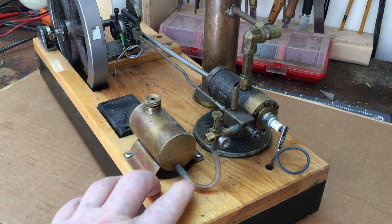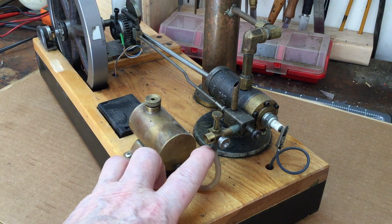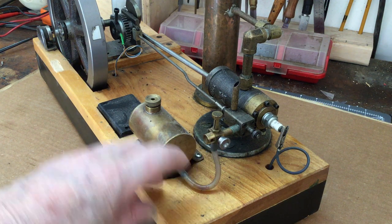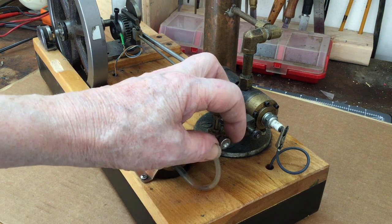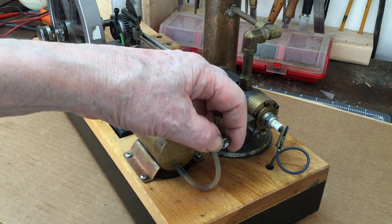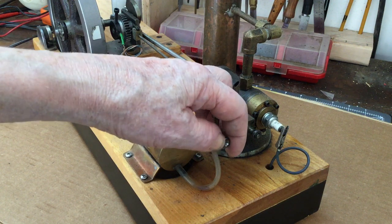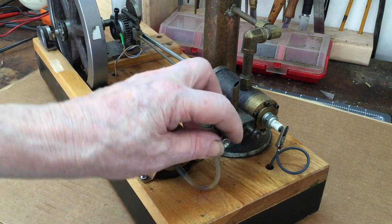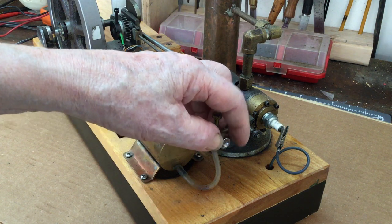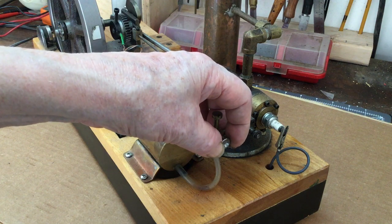This is the carburetor. You can see it has a fuel line that runs from the gas tank up to this little connector on the bottom of the carburetor. This silver knob here is the throttle — turning it clockwise decreases the RPMs and counterclockwise increases them. I usually like to run it at about one-quarter open. Go all the way to closed, but don't force it or you will damage the seat in the carburetor. Open it just to where it stops turning and then about a quarter of a turn.